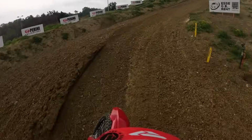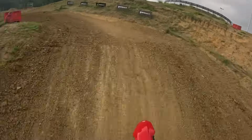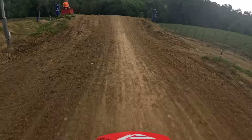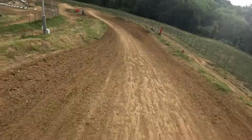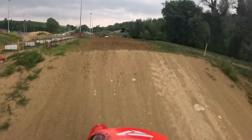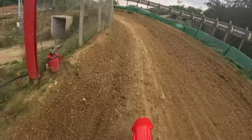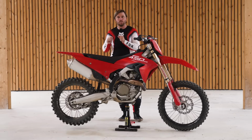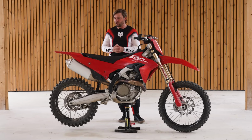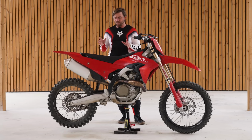It's basically gone to an algorithm point where the bike knows if it's exiting a corner, that if it senses a change between the dynamic speed of the bike and the rear wheel, it'll start to cut in some form of traction control. So in my opinion, it's the only true legit traction control we have in motocross. It has 4 settings. There are different levels of intrusion. I tried each one. On one hand, it is one of the most enjoyable systems I've run. I don't really like anybody else's form of traction control. Again, I think it's too intrusive because it affects too much on jumps and whoops and things of that nature.